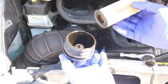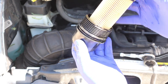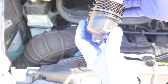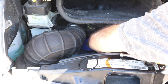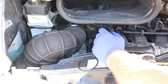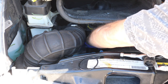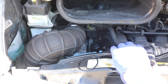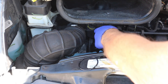Take your new filter and make sure those little plastic nibs are still there — it will snap in and you'll hear a click. Then screw the cap back in. Turn it counterclockwise first until you feel the threads click into place so you don't cross-thread it. Hand-tighten it first, then use the stubby wrench to snug it up.